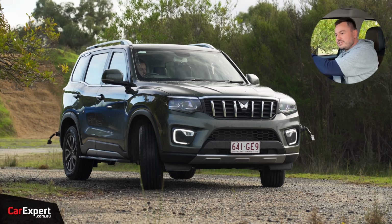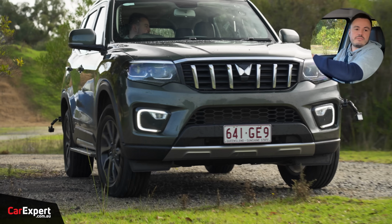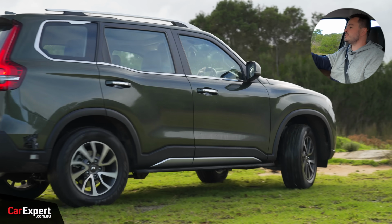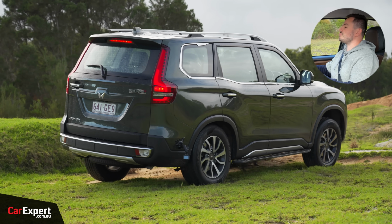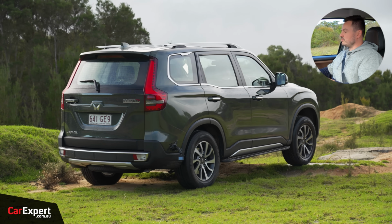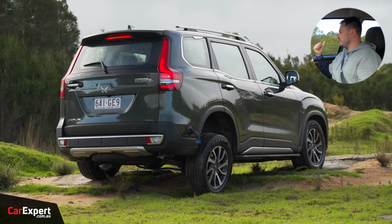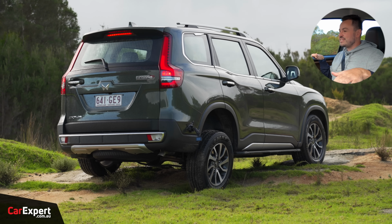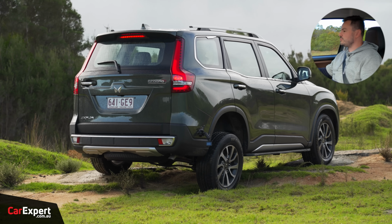So what we're going to do is go to our offset Mogul first in two-wheel drive high range. So this is basically going to give us an idea of how well the traction control system works. And based on how well it works here, I can move through some of these drive modes to see if we can improve it as we go. So we're going to get to a position where that rear wheel on the driver's side is lifted off the ground. Currently we're seesawing effectively, so we have 2 wheels off the ground. I'm going to roll onto the throttle here and we'll see how well traction control works.